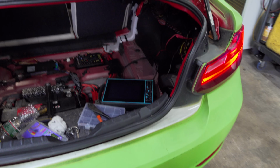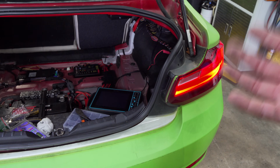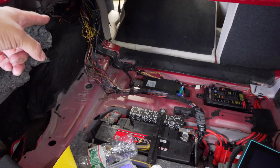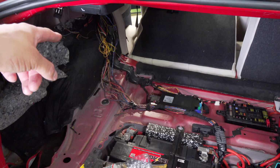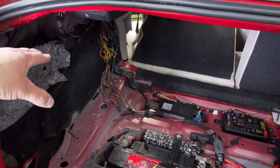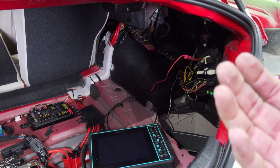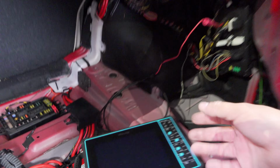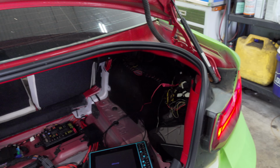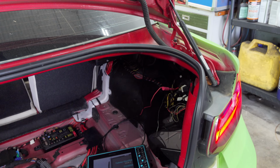So I don't typically close out videos like this, but under the circumstances, this is where we are. This car has been crashed. I went ahead and repaired the wires, and some of those KCAN wires are still shorted to ground, so I had to not connect some of them. We did this as best we could just to get the rear electronics module programmed. I hate to leave videos like this, but I think it's still useful because you can see KCAN modules saying hi and not getting a response. That's valuable information. I think everyone should be able to recognize a module that is trying to speak and not getting a response.